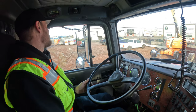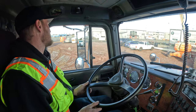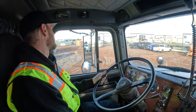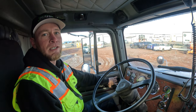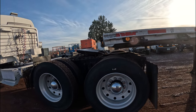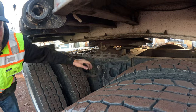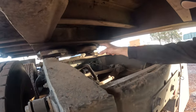Back the truck up into the trailer — make sure you're straight and can see both sides of the truck in the mirrors, and back slowly up underneath the trailer. Set your brakes, get out, and verify that the jaws locked in around the kingpin. You can see from right here that your pin is in, but still get underneath to look up and make sure the jaws are actually locked around the kingpin.